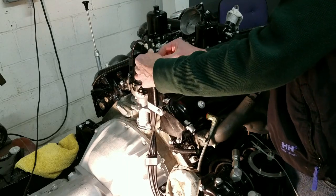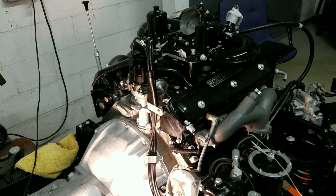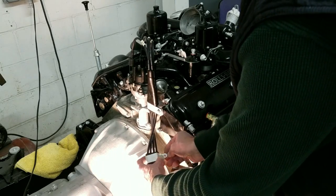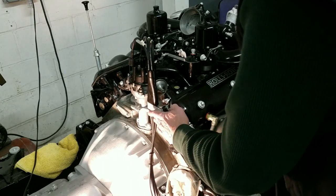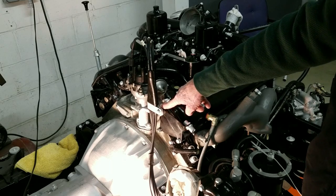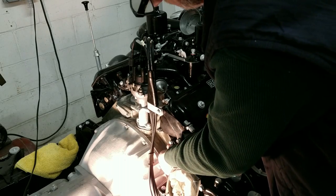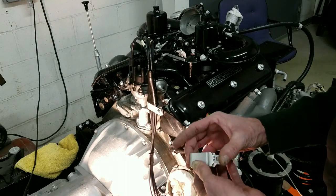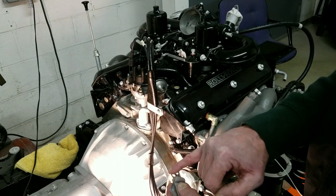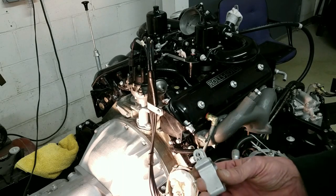Making sure I've got an even curve with all of those coming out of there. The next one - I've got to take this bottom water pipe out. You'll notice this is a different type clamp here - I got it on there the wrong way, just put them on there to hold the position. The way that slant goes in the firewall is awful close to the back of this engine, so it tucks in, and if you put it the other way I think it'll bang on the wires on the manifold. This one's also the same way - it tucks in just like that. These are different sizes - this one's got a little indent where the others don't, so you've got to get the right clamps. I always mark them so I get them in the right place.